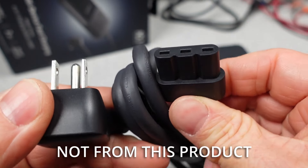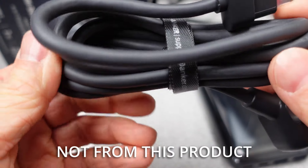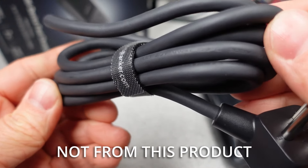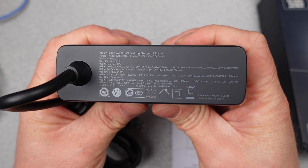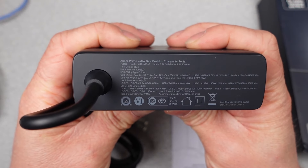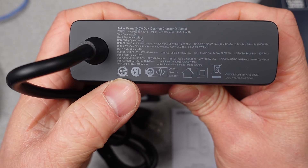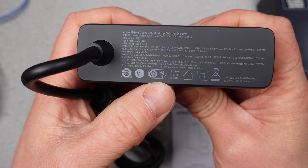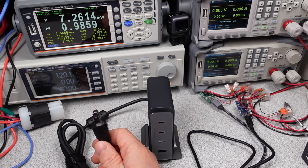The cord is fixed and placed with a rubberized strain relief. Yeah, for $200, it's a little screw you. They could have used their fancy proprietary connector from the new power strip thing, but no luck. When flipping the adapter around, you see lots of text and different marks on the product. For one, we see a 6 in a circle. This is indicative of compliance with the Department of Energy requirements. In this case, the power adapter has an idle power usage of 0.14 watts and an average DOE efficiency of 91%.